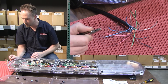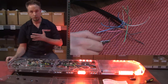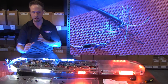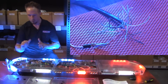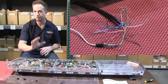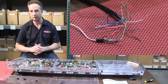Front-facing only through the corners and the multicolor inboards — the vibrance of red, blue, and white flashing away. Putting power to a couple other triggers here, showing another example of warning mode, tying in the multicolor centered modules. With Code 3's multicolor and single-color format, it's a great way to really customize your overhead, letting you take advantage of what you, the end user, really need. On the front of the light bar, we're going to take a trigger wire — this is the green with white. Right out of the box, it is a front cutout, so if you simply need to hit a button and disengage the whole front of the light bar and its warning scheme, easy enough to do.